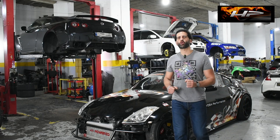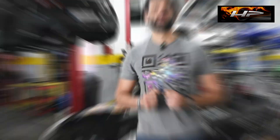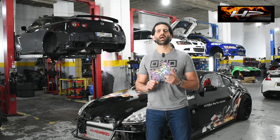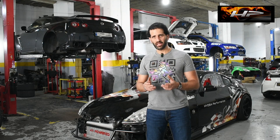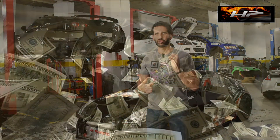Now you probably know that the stock high-pressure pump needs a bit of help at higher power levels, and especially with higher E-mixes. You can rectify this by adding meth, port injection, or an external high-pressure overdrive of some sort, but these all add weight, complexity, and additional points of failure to the vehicle, in addition to costing hundreds if not thousands of dollars.